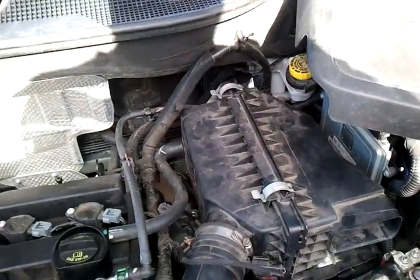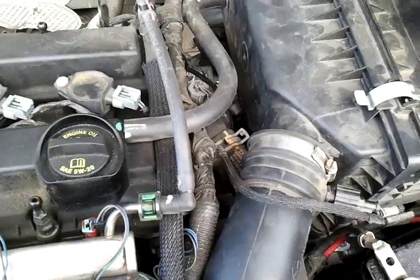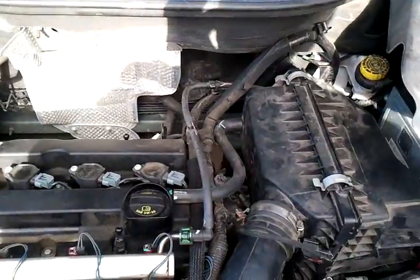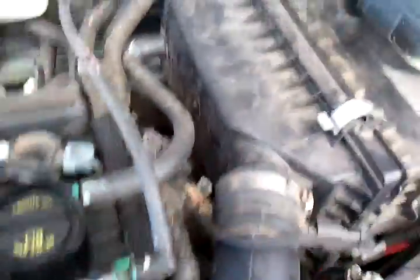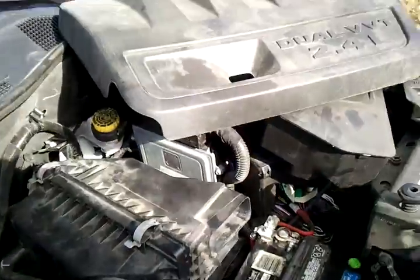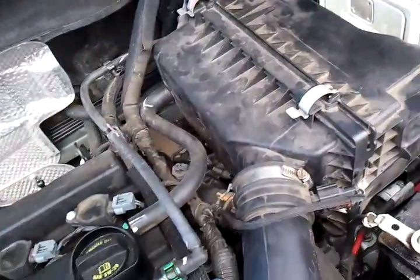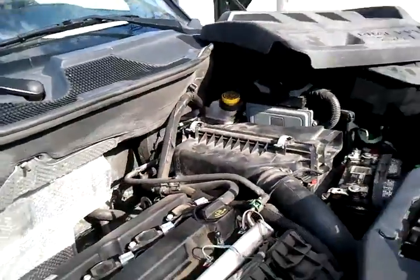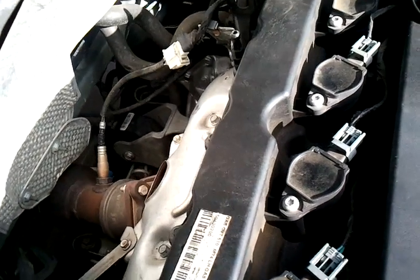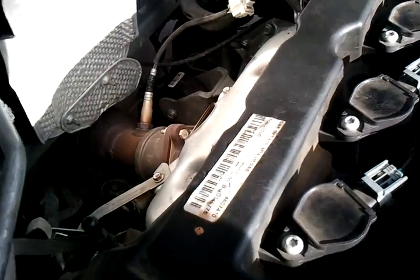I also took the air box off, which wasn't part of the instructions in the manual I read, but it helped a lot because right underneath the air box is the transmission. You'll find yourself needing a place to hold yourself up, and putting your hand on the transmission seems to be the best way to do it. After taking off the battery cable I also removed the cables off the computer, just to be safe, so I unplugged that to move it out of the way. Then I lifted the air box off.